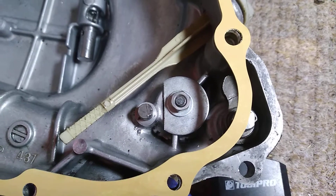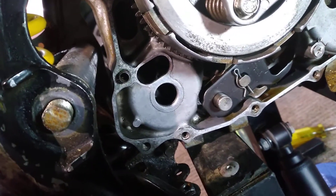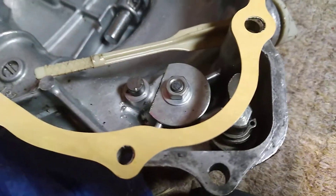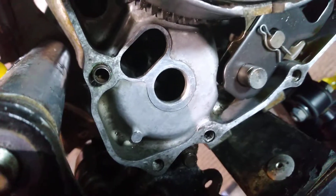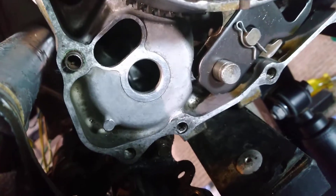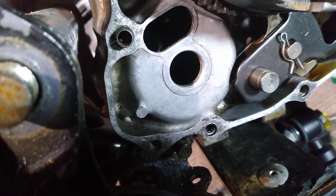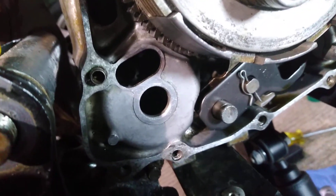That extended piece is to allow for the compression release mechanism. There is at least a hole there and a thread back here on the crankcase. So I think what I'm going to do is make up a nice little aluminium section, bolt it on, make it the same contour as this, and put one bolt and a gasket to complete that little section. Although it's a blind area on the crankcase, I believe oil will seep through that little groove there, get into that space, and actually come out — so that's my little challenge which I'll have to go ahead and do.